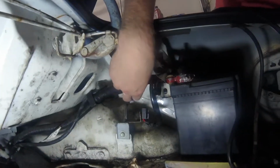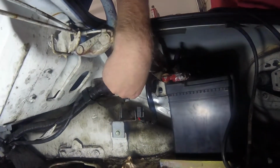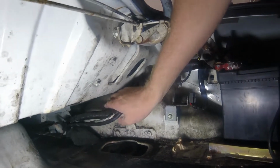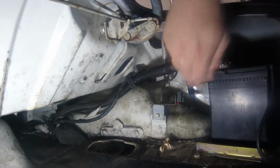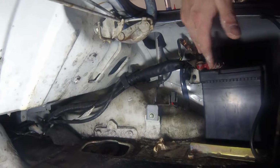But playing around with it more, I found out that there was actually a short somewhere in here, because when I grabbed at this position, the lights would come on, and I could even turn it to the point that I could get them to click on and off. So since I can grab down here and pull and move and nothing happens, but from here it does, I'm 99% positive there is a problem between here and the battery terminal.